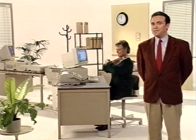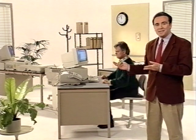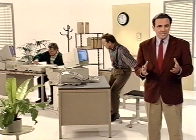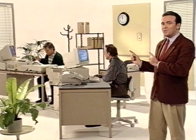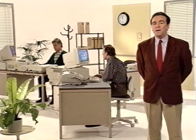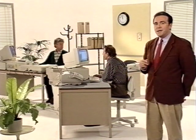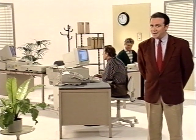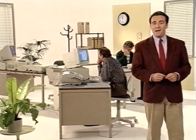Let's see what happens if somebody else sends you a fax. With the Canon B360, you can receive up to 70 pages, and it's up to you in what way. You can choose a hard copy printout, like any standalone fax would give you, or you can store it in the memory of the B360, read it on your computer screen, and decide afterwards if you need a hard copy as well. This option can save you a lot of paper and filing. The advantage over a PC fax modem is that you don't have to leave your PC on 24 hours a day in order to be able to receive a fax. Thus, the B360 combines all the benefits of a standalone fax with those of a PC fax modem.